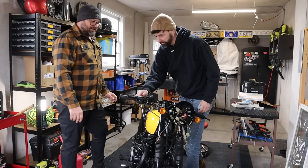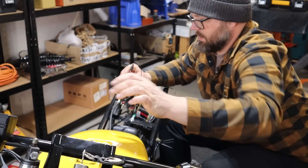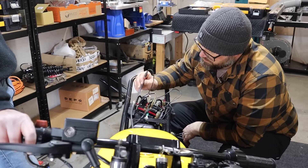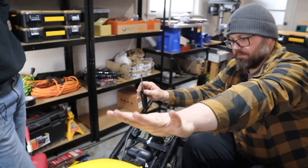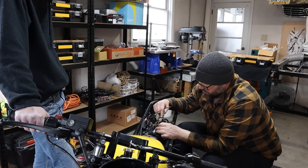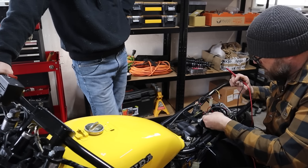Right now my main goal is to see if we can get power and then we'll crank and maybe we'll get lucky and hear a little burble and a little running. We'll see what happens. Still a lot closer than it was. Push the button, see what happens. We set to run — give me a little... I got nothing. Key on. So ground not grounding. Got nothing. Okay, we don't have anything coming across this solenoid. We're just not getting power through here — it's either because of this or something between there and here. Push the starter button for me. You getting juice? No — that's the neutral switch.